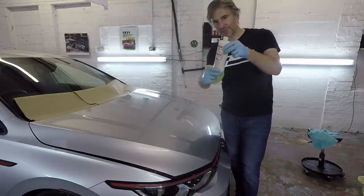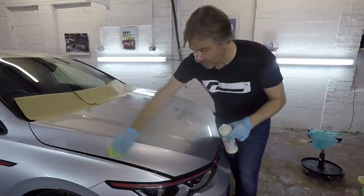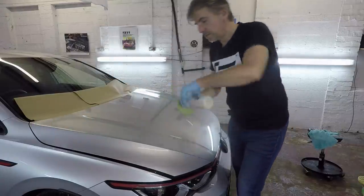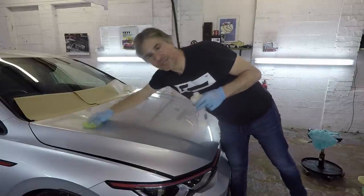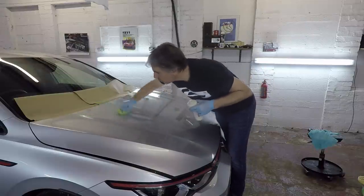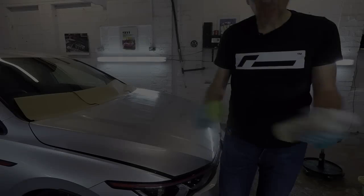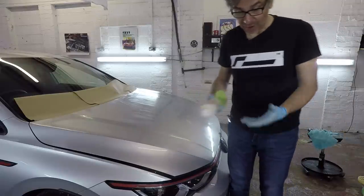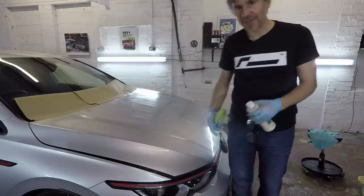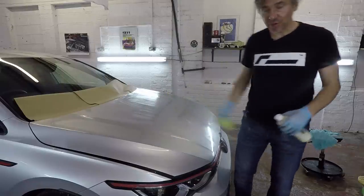Now this stuff is very temperature sensitive — I used it in winter and had to put it in some boiling water to make it liquid, so just bear that in mind. You don't get that with Auto Glym wax, but Auto Glym wax is a lot more expensive. It does go on really nicely and you don't need to apply an awful lot — just get it to look a bit hazy. Leave it on until it hazes — no particular set time, which is actually good advice because depending on the temperature it will take longer or shorter. I tend to leave it for about 10 minutes.